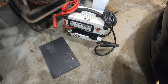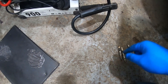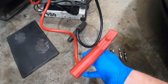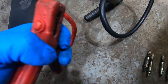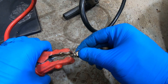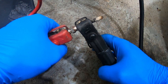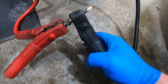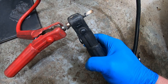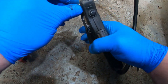I could test some brand new ones, but I want to see if these work. I'm going to replace them all anyway, but possibly keep the new one as a spare. All I'm going to use is a simple jump pack. We're going to touch the positive to the end terminal and ground out through the body. This is number one — the one that's never been replaced. We turn it on, and what we should see is that end glowing. Clearly, it is not. That one's duff.